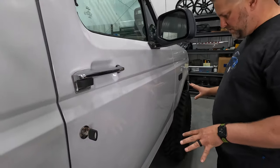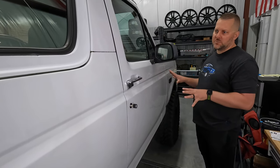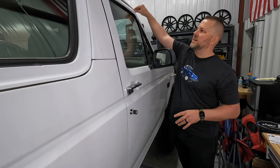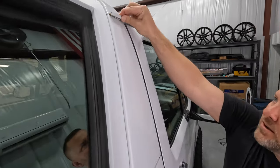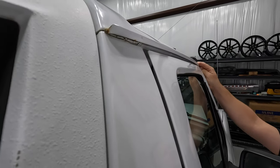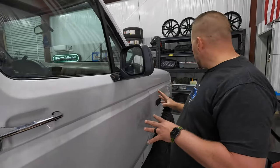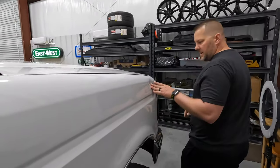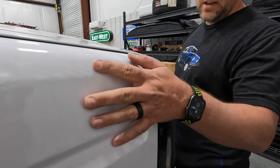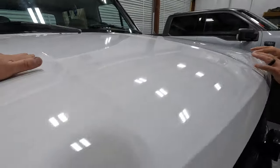This side's pretty good — you can tell where it's been touched up with paint over time. We're trying to get the body straight and looking good; we're not going for an A-plus show-quality paint job. There's also some of the little stuff where the glue and caulking have separated on the drip line — it looks bad. And there's a big knock in this front fender that we'll try to get pulled out.